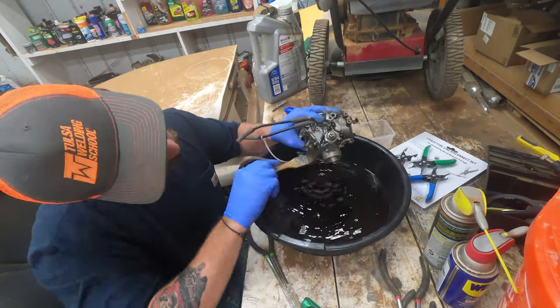I'm finding all the holes I can and giving each a nice spray with carb cleaner. I don't actually think I had to use a wire brush for these because the soaking in gasoline helped dissolve the varnish, and then I was able to just hit it with carb cleaner. Your jets are brass, so the gasoline won't hurt them. As long as they're in good shape you can reuse them — just give them a nice thorough cleaning. Here I'm using a flat-blade slotted screwdriver to install them back, along with the o-rings. I'm using a pick to get off the old o-ring and put a new one on.